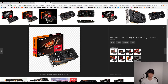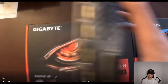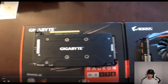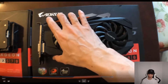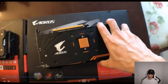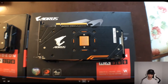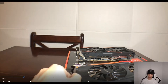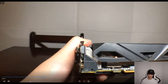If you own the RX 570 or 580 Gigabyte, as you can see when I flip this over, this is a Gigabyte RX 570 — or even a Gigabyte Aorus RX 580 or 570. If you look at the front, it has a Gigabyte fan instead of an Aorus fan, because the original did break and I replaced it. To replace the fans, you have to unscrew the faceplate off the GPU — there are four screws.